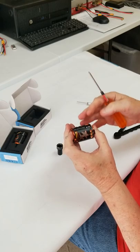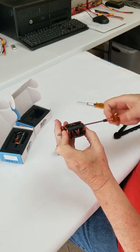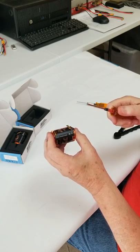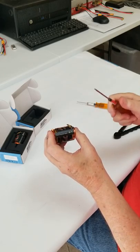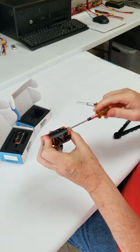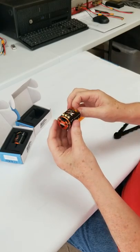The aluminum screws allow the motor to produce more torque than steel screws do, but even though these are hardened screws you can still strip them, so be careful. I wouldn't recommend using any electric pistol-grip driver for final tightening — I've seen guys strip even steel screws that way. I always do the final tightening by hand with my hand tool, just a snug fit — not cranking them down hard.